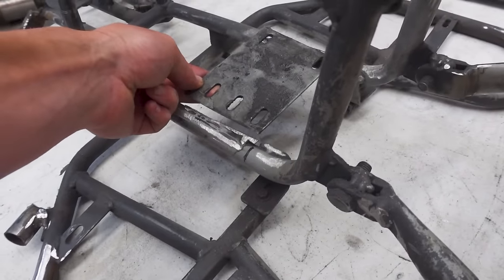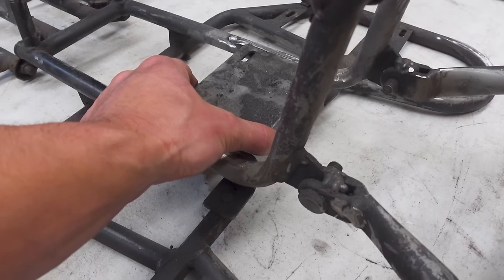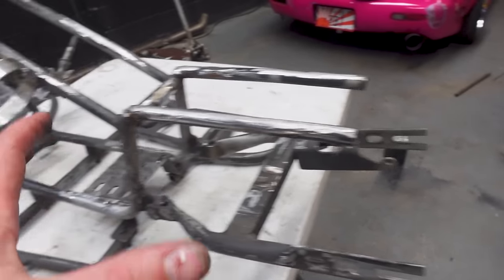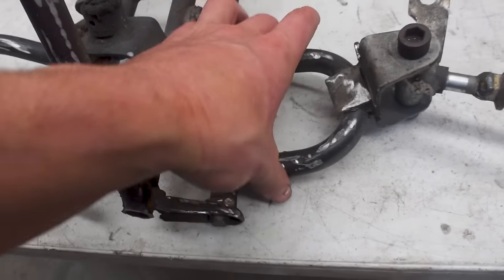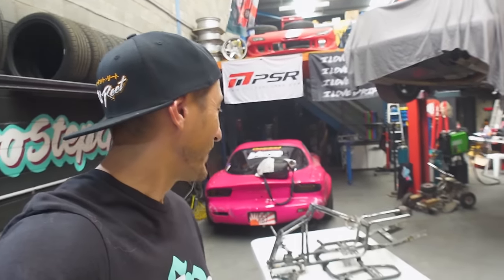The next step is extending the frame. We have an engine plate that I cut off the frame, and I've marked where it used to be. I'm going to shift it back as far as I can, measure that distance, and extend the rear of the frame by the same amount so the chain still fits nicely on the motor. Up front we're going to cut our LCAs and shift them as far forward as possible, giving us another 20mm of length on our cart. I'm so excited to see this thing all one colour - let's extend the frame and then I'll show you the colour.